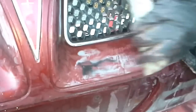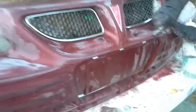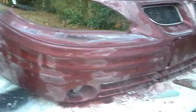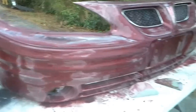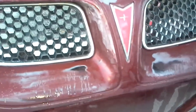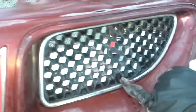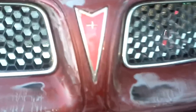So what do you think we'll have in this when we're done? Well, we went to the pick and pull, pulled this nose cover for $30, and then the Duplicolor is about $8 a can, so you're going to be in this little project about $50, maybe $55. We're going to pull the grill pieces next. Anything you can take off for the paint is what you want to do, because it leaves lines. This particular one has the little star keys, probably some pop-ins, and the Pontiac emblem is adhesive so we're just going to cover it.